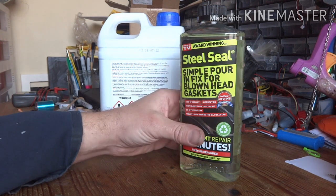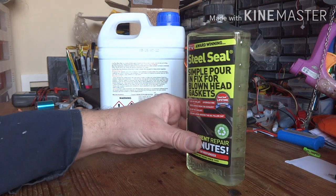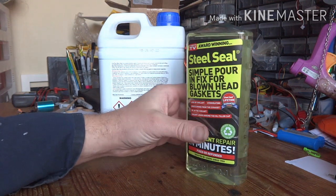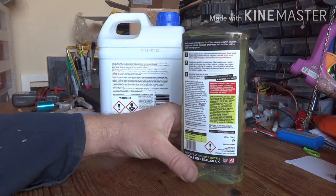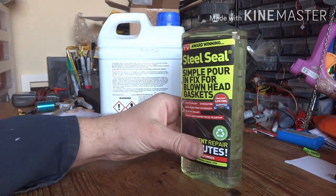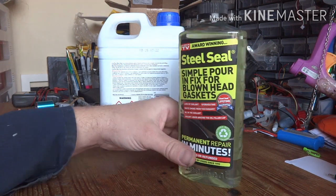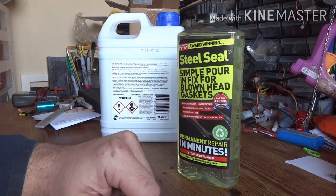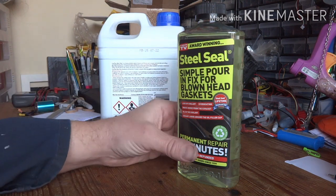I think when it overheated it took the head gasket with it as well. We're getting a lot of vapor out the exhaust, it runs slightly rough, and there are bubbles around the radiator. I think we've definitely got some exhaust gas entering the cooling system. It's a 22-year-old car, probably not worth getting the head gasket repaired properly. The mechanic actually recommended Steel Seal - he said he's used it before and it might work, might not, so it's worth a try.